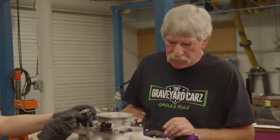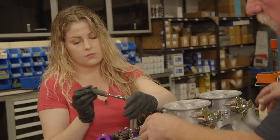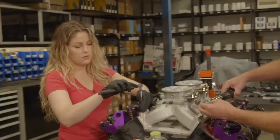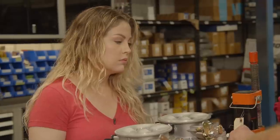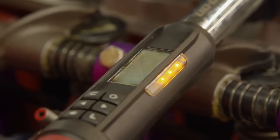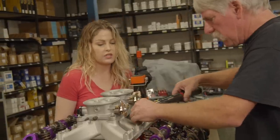This intake is a little bit different because the cast iron intakes we normally put on take bigger bolts and set in a little better than this does. This is really taking a lot of time because the torque setting is so light, and to compress this gasket I want to bring it down evenly before I start torquing it. We're going to start at a real low torque setting, starting in the center — this is going to be a real tedious job. Do you just know these numbers off the top of your head? No, I read the service manual.